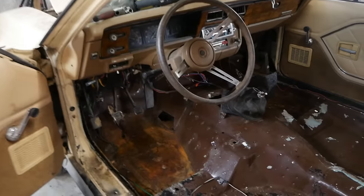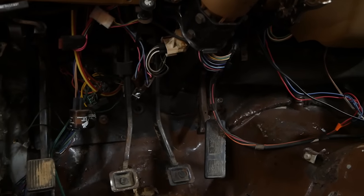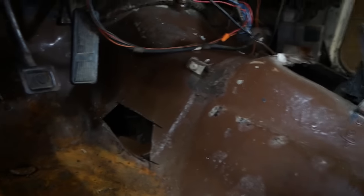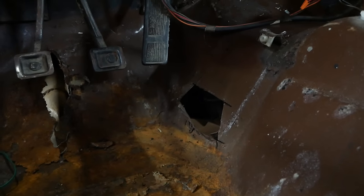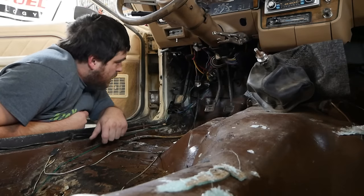We're out here for another night. Now that we've got this baby all cleaned out, let's see what we can do about this clutch master cylinder. I ran the numbers on the VIN — in the fifth spot there's a K, which means automatic. So this is not an original stick shift car, which is kind of verified by the giant ragged hole in the tunnel. The mystery continues. I'm going to start by pulling this brake booster out because I already know that's something I need to do.